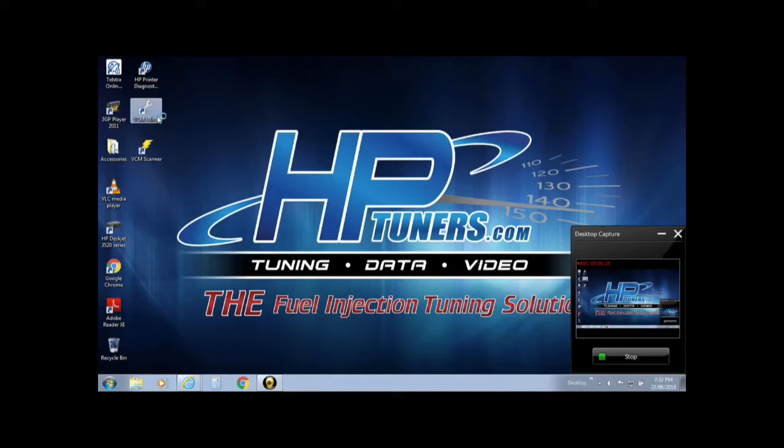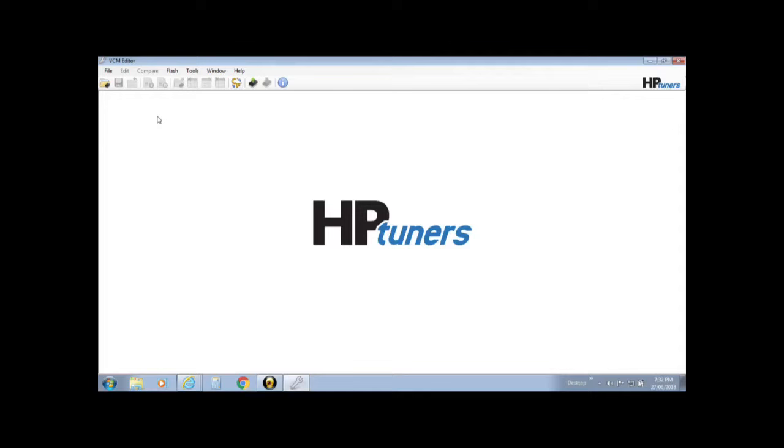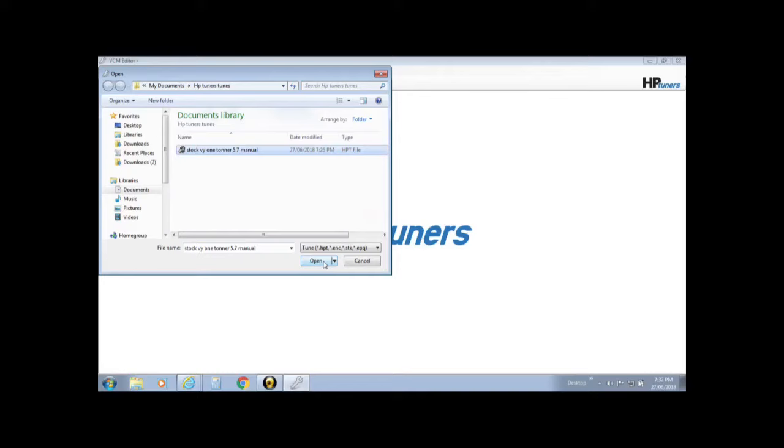To open the editor, go out to your car, plug your dongle into the OBD2 port, and plug the USB into the side of your laptop. You'll open up the editor and you'll want to read the vehicle — read what's in there. I'm not out at my vehicle right now, I'm sitting in my office, so I've already done this. Do that, read it, and your tune will come up. I'll just open the standard tune that I've already previously done and it'll be the same.